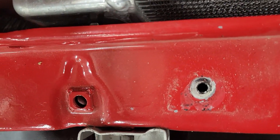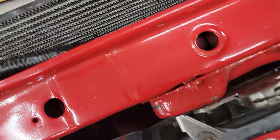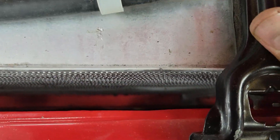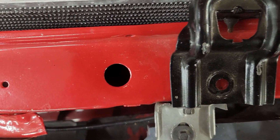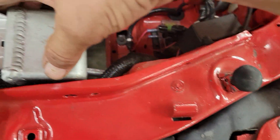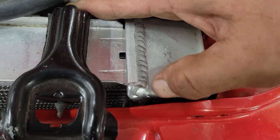The dilemma I had was the rad was up against the wires over here, so we're going to do a wire tuck and attempt to move the radiator closer to the rad support. As you can see, I had over an inch to an inch and a quarter of room in there. We're going to bring it up even closer. I'm not sure if I'll be able to lower the radiator enough for it to tuck underneath, but we need at least an eighth to a quarter inch gap just to keep things happy.